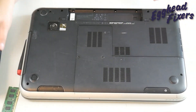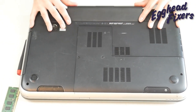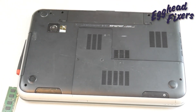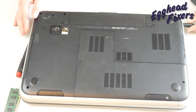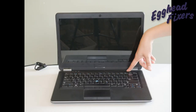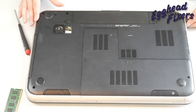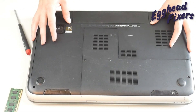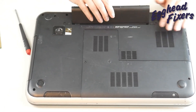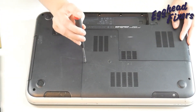The reason I'm doing this is: if the computer turns on with just one stick of RAM installed, then I know that the stick of RAM outside of the computer is the one giving me trouble — it's preventing my computer from displaying. So if I turn it on and it works, great. If it doesn't work, I'm going to repeat the process and swap in the other stick of RAM to see if that's the one causing the issue, because a bad stick of RAM can prevent your computer from displaying properly.